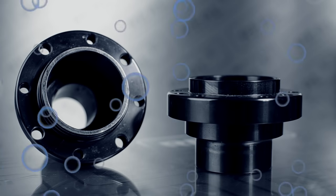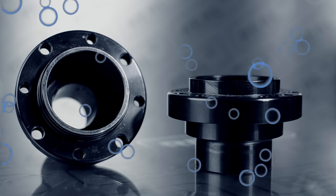A quick installation tip: you're going to want the engine cold and you're just going to boil the hub in water. Get the hub over 200 degrees, put some oil on the nose of the crankshaft, and you'll be able to slide it on. If you try to put this on cold or with a hot crankshaft, it's not going to fit — there's too much interference between the two. So this has to be hot, the engine has to be cold, and it will get on the nose of the crankshaft.